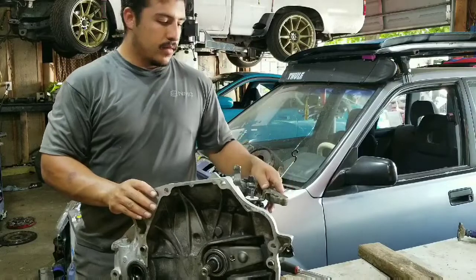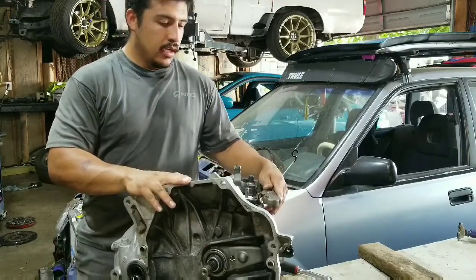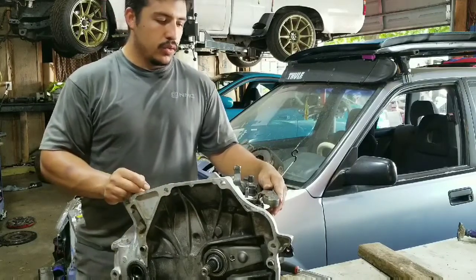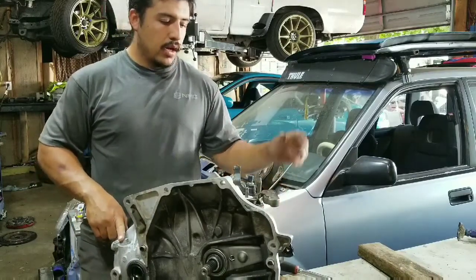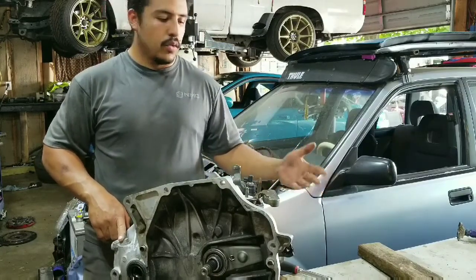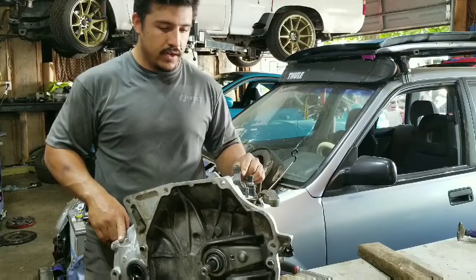In this video I'll be covering the 06 Si tranny. We're going to be converting it to run with the 02 to 04 RSX harness, 02 to 04 speedo, and then we're converting obviously to be able to run it on 02 to 04 shifter cables, because obviously that's different.